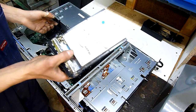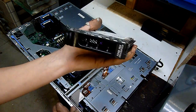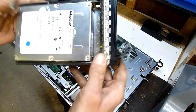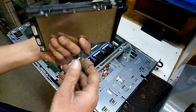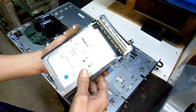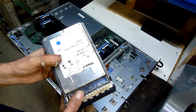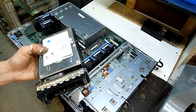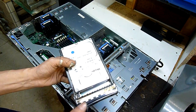For example, there's an Ultra drive. They're all caddy mounted, fairly small capacity. This one here is 10,000 RPM, 73GB. Due to the high RPMs, this drive can transfer data very quickly, especially when you've got 15 or 20 students or office people smashing data at the server all at once.